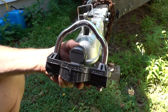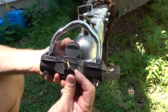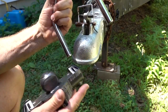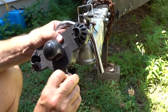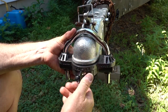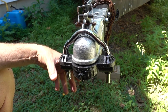Alright guys, let's take a look at this Trimax. There's a little rubber cover right here in the front — pull that off, right on the front of the lock. Very convenient, both for the user and for someone trying to pick it. It is a seven-pin tubular lock, so we just turn it like that and the bar comes right out. Now you'll notice the teeth on both sides, but these are not spring-loaded teeth — you actually have to turn that key in order to mechanically move them into place. So I'm going to slide that up inside of the hitch, lower the bar as far as it will go, pinch it together as tight as you can, then rotate it so there's not going to be a lot of play.